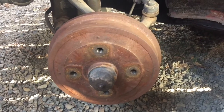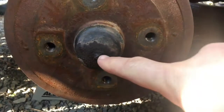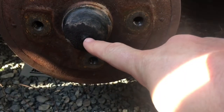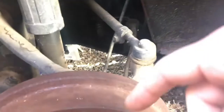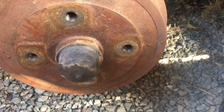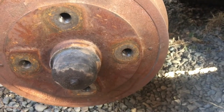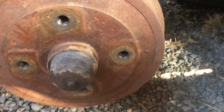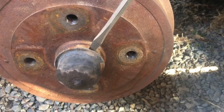We're going to tackle the front bearings here. This is the driver's side, and the one thing you'll notice is this little bump right here. That is your speedometer cable, which is right here — it goes up through the firewall. Interesting way to drive it: rather than off the transmission, it's just off the front hub. So on your driver's side you're going to have this cap with a hole in it and a little square bit — that is actually your speedometer cable.